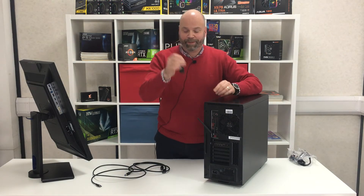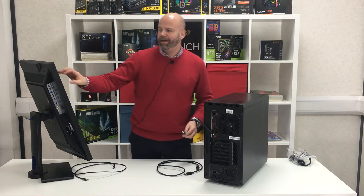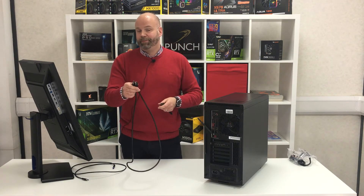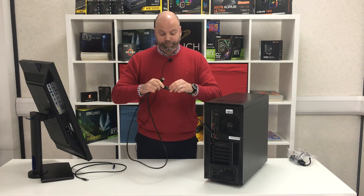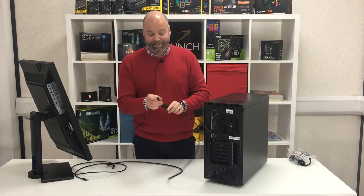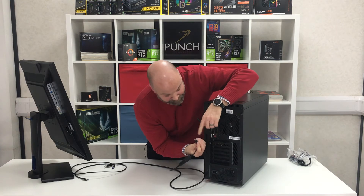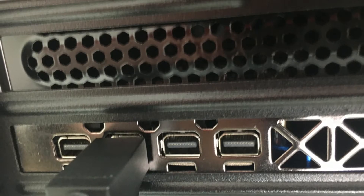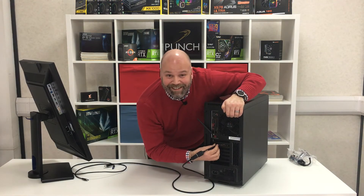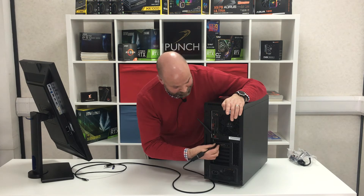This is where the mini DisplayPort adapter comes back in. It's quite rare, even for the monitors supplied by us — which are generally BenQ — for them to already come supplied with a mini DisplayPort to DisplayPort cable, so you need the adapter. If you've got one of these cards in the PC, the accessories box will have one of these in it. These are gendered as well — there's a little clip on them and you can see the corners are chamfered off. You're able to pop it into the PC. They're quite small connectors, but once it's in, that little clip holds it in place.